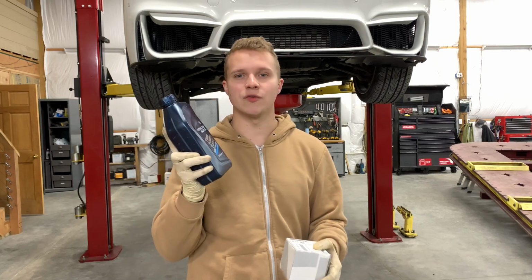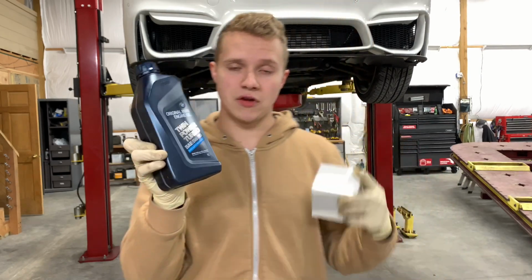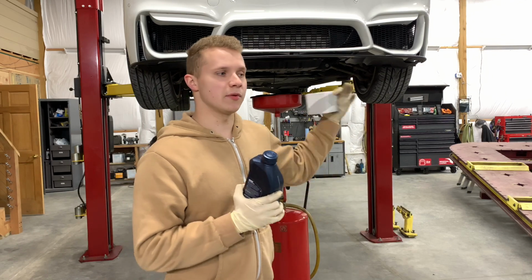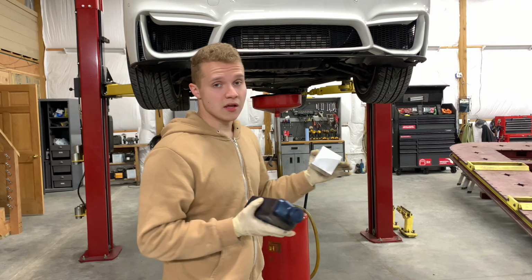And if you are looking to buy oil, get the 5W30. That's what your car will need if you have a BMW. Almost every BMW I've ever owned had 5W30, and I put full synthetic all the time.